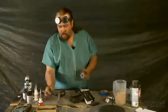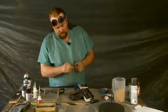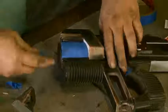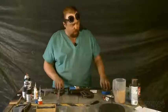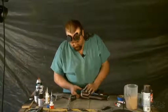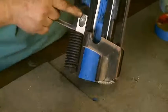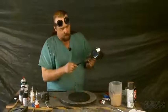I don't want this piece in here, so I'm going to pull this out because I want that nice and clean. But I don't want paint to get up inside, so I'm going to mask it off from the back side and then put it back in because I do want to prime that area. The insides probably need a little touch up. Once you get into primer, it's nice because it really shows you where your problem spots are. Black primer gives you deep shadows — it shows if there's anything hidden and it'll come out real rich and dark. This little spring-loaded switch releases the clip — that shouldn't be a problem getting any paint on it.